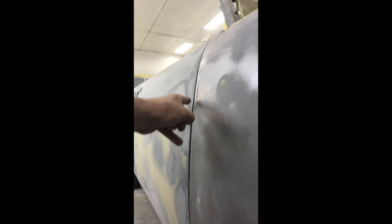All right, I've been doing metal work on this fender. It came out really nice. A lot of hand dollying, hand pinging really to get in between it. I pulled and worked that edge real good, but it was in about 3/16. If you look down at it now, we're really... lost out of focus, I think. But anyway, there we go. It's really, really smooth, just metal to metal against the fender and the door. All this area, right through here, from right about here down to here, was really in.